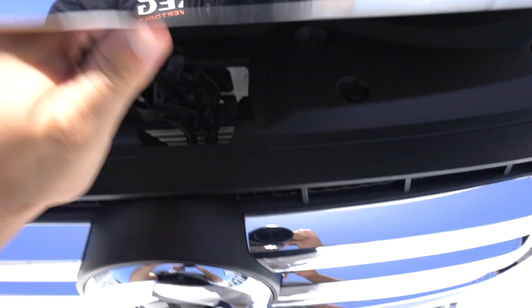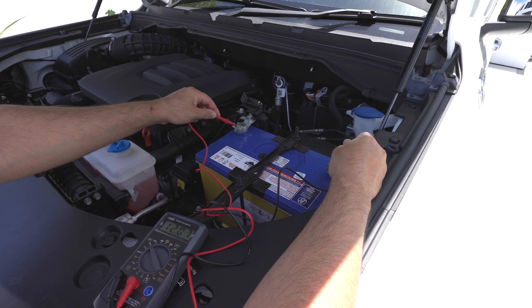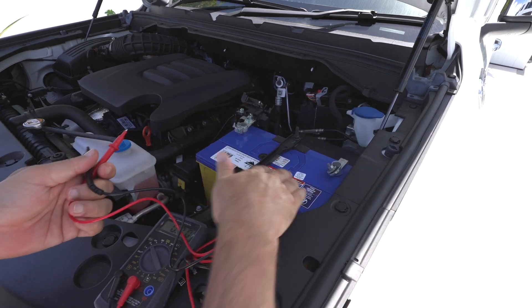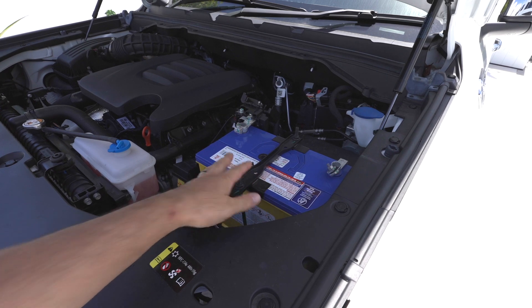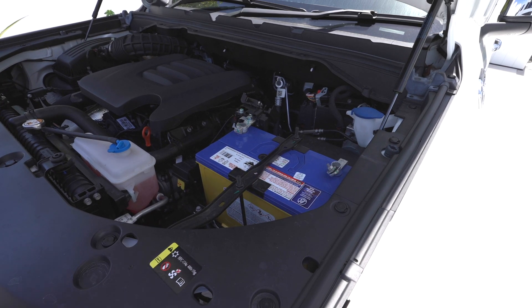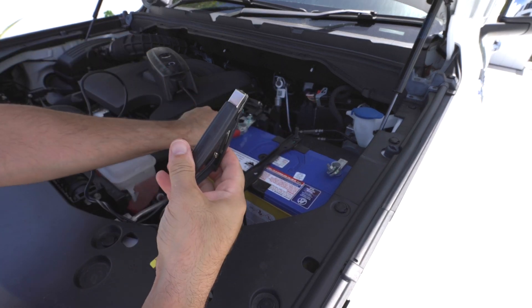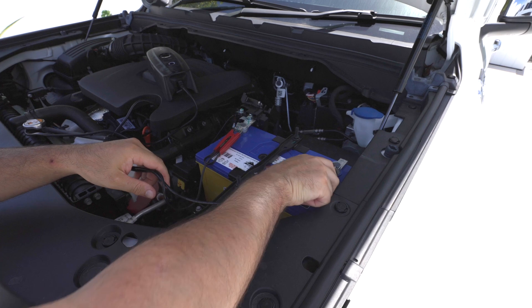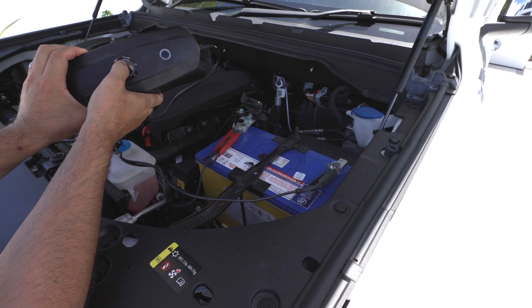What I want to do now is pop up the hood, plug it in to the battery, trickle charge it up, and see how long it lasts. I'm thinking if it lasts more than a couple of days — if it lasts a week — that's going to be awesome because it means it's working. So let's go ahead and hook up my multimeter. I can see that it's 12.07 volts — it needs a bit of charging. So it's good to have the CS3 plugged in. I'm going to start charging up the battery and you can see it's on the start.